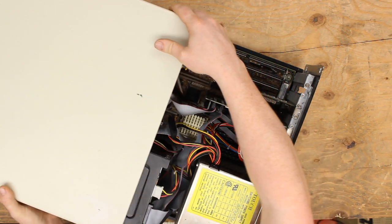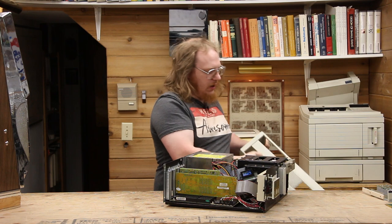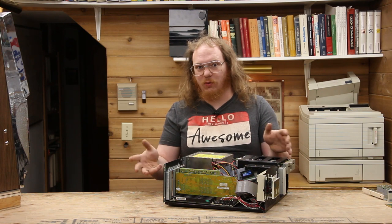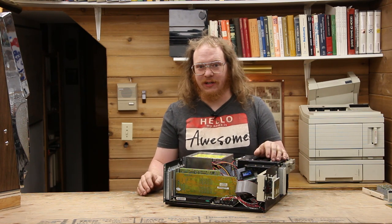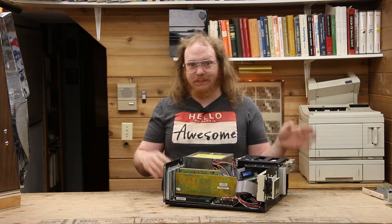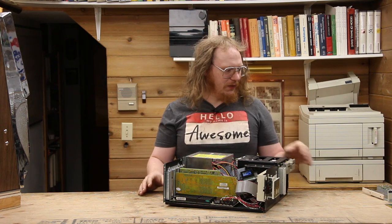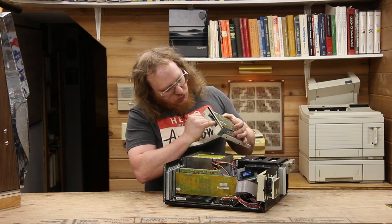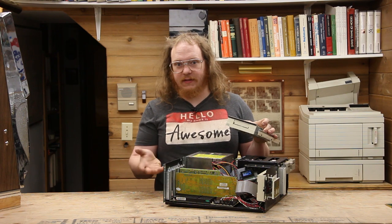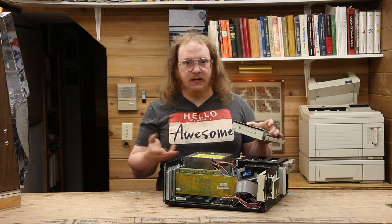Now as I open this machine up, I'm going to admit I've cheated a little bit. I had to actually go and test to make sure everything worked — even though I've owned this entire setup for 20 years since I got it at a garage sale and it worked fantastic back then. QIC has a major drawback compared to simpler tape formats like 9-track in that it has more moving parts. The drives are known to have a problem where the roller inside, which interfaces with the cartridge, can degrade and turn into a nasty rubber mess, which will make the drive not work and also contaminate and potentially ruin any tapes you put into it.